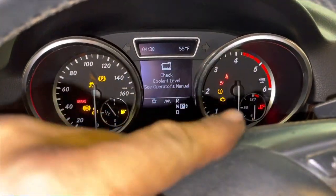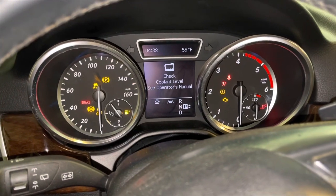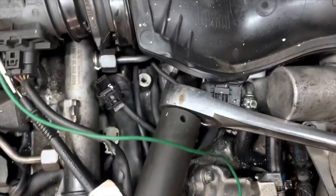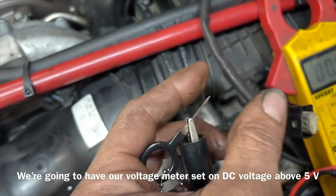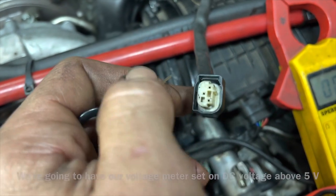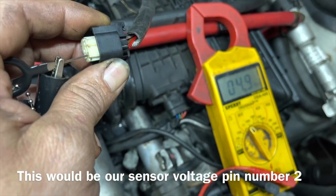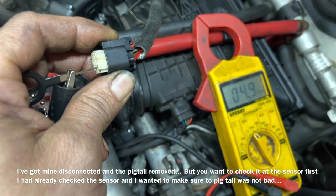With the key turned on and all indicator lights illuminated, without the engine running, we should be able to check the wire for five-volt reference. It's important to do all of these checks — if you don't, you may get a misdiagnosis. For our first test, we're going to hook our ground lead up to a ground, take our plug off, and using the red wire on the back side we're going to barely touch inside there. With that inserted, we should have about five volts — which is 4.9 — and that is correct. That tells us our ECM is sending a signal down to the sensor.